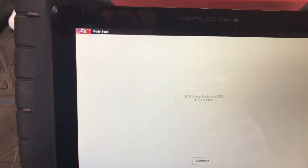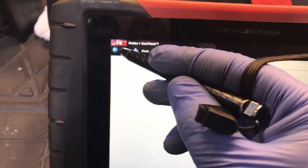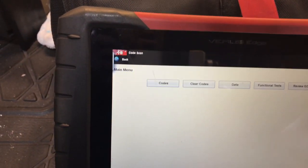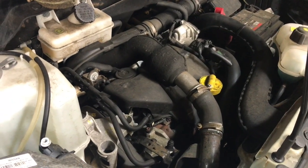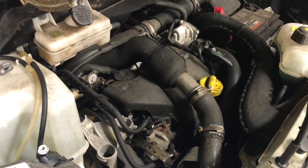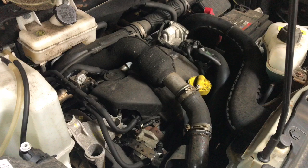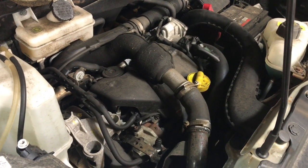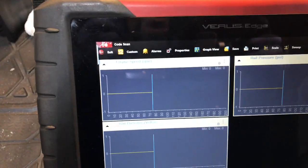We actually started this off camera, and it has got an extended crank time. The second time we went to start it, you could hear the engine idle was lumpy. So I think the best thing to do is put a genuine Renault or Nissan filter on it first, establish a good basis, and take it from there, because air is an absolute killer for these things.